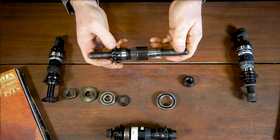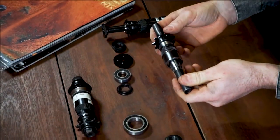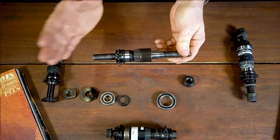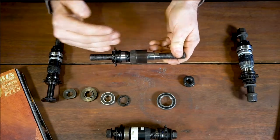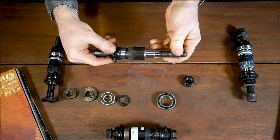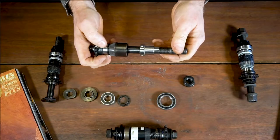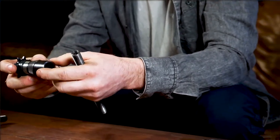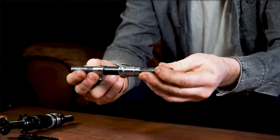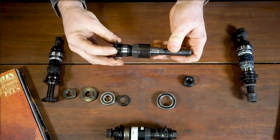The next system is the resistance mechanism, and how your clutch is relative to the axle and the driver. Your resistance mechanism works across the board in most free coasters exactly the same way, maintaining the clutch's relationship to the axle. It should only move axially along the axle when it's functioning, until it engages or fully disengages. Resistance mechanisms can be a number of different styles. On a lot of popular free coaster hubs there's a two-pin bearing system that sits on and runs on the inside of the clutch, creating your resistance on the clutch against the axle. This particular one is a little different, but the concept remains the same — basically all free coaster systems work that same way.